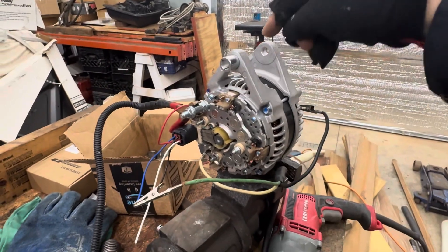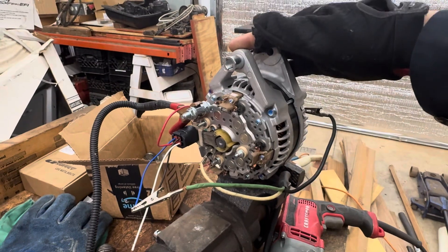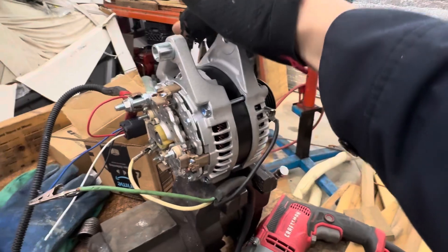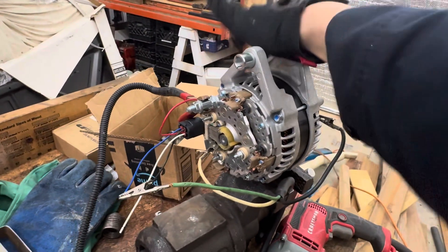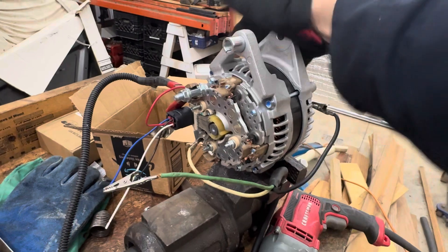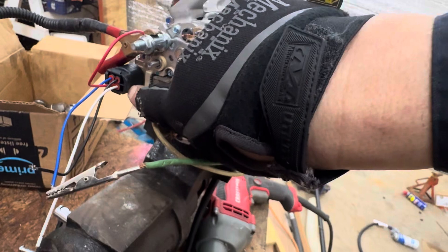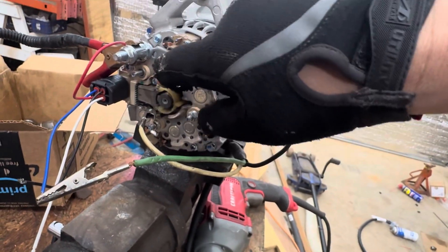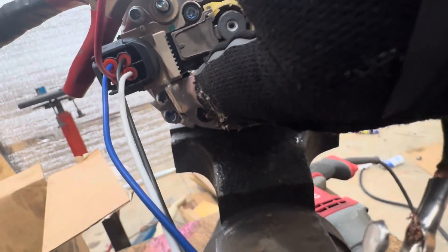I want to convert a computer-controlled Denso alternator to a one-wire. This is the cheapest one I found — $80 on Amazon for a 2001 Dodge Durango. The regulator I bought is for a Lexus — four-pin, Lexus and Toyota are the same. I soldered the terminal right there. You need to crimp and solder that connection.